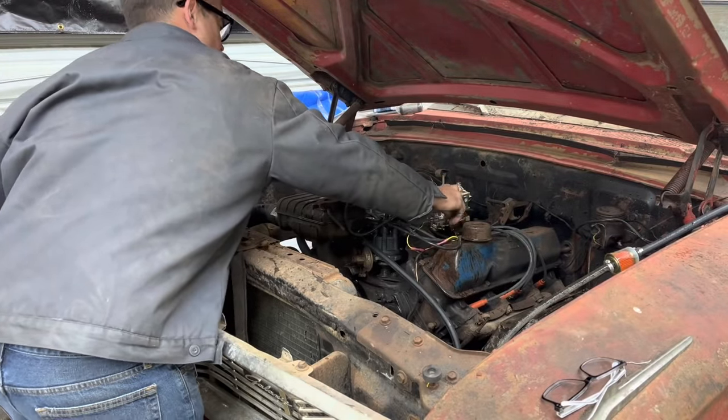Guys, I'm telling you, I have worked on these brakes for hours and hours and days, and I can't get this thing to bleed. I have no idea what's wrong. I thought the rear brake line had a bunch of air in it, so we tried to bleed at the back. Then we kinked it, then we took it out, put the new piece in like you saw, and kinked it off. So now the only brake system is here and here. There's nothing to it. There are no leaks anywhere. And every time you pump the brakes, bubbles come up here in the master cylinder.